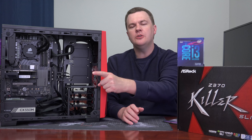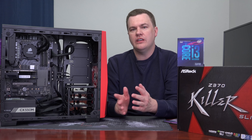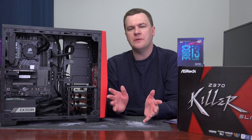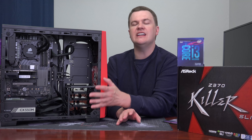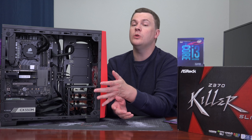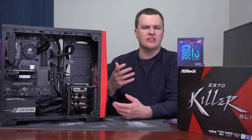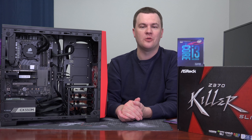Finally, would I put a GTX 1050 Ti in here? No, I would put a 1050. I don't think the extra 2GB of VRAM is worth the cost difference at the moment. You can currently get GTX 1050s for really close to $100. An RX 560 would also be adequate — 2 or 4GB depending on the price, somewhere in the $100 to $120 range would be plenty. I fully acknowledge that 1050 Tis aren't a great deal and the RX 580 really is a better value long-term. But for most of the games I've tested on this machine, the 1050 would be fine. For what my kids play — Overwatch, League of Legends, World of Tanks, World of Warships, Minecraft, Roblox, Sims 4 — a 1050 would be plenty.